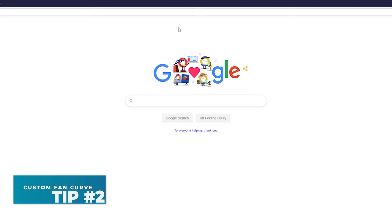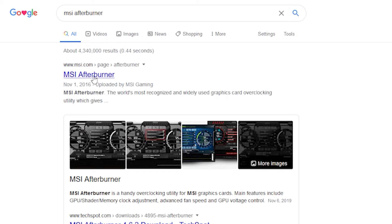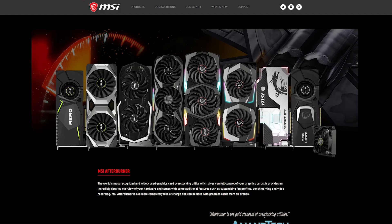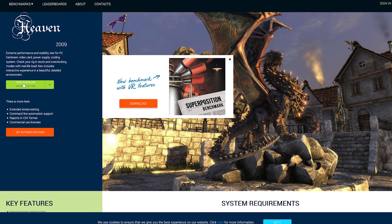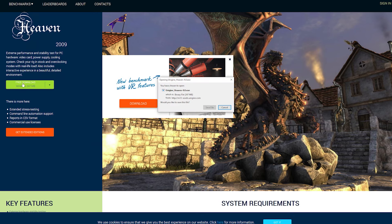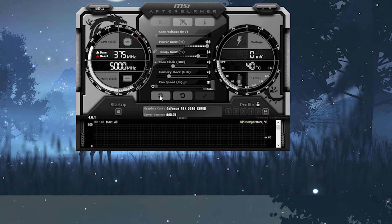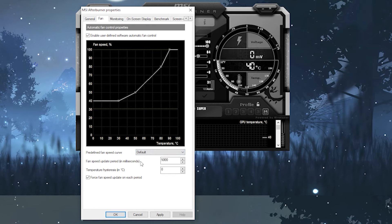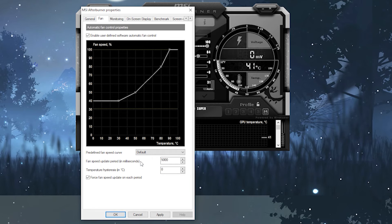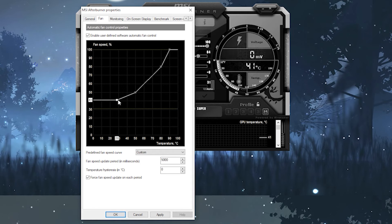Now if you have a fear of opening up your computer, taking out your GPU and disassembling it, then this next step will probably be your starting point, and that's creating a custom fan curve. You can use any software that can control your GPU, but for this I'll be using MSI Afterburner and Unigine Heaven. Head over to the Afterburner site — links below in the description — and download the install. Same thing for Unigine. Once those are downloaded and installed, open up MSI Afterburner and click on the settings button. Select the second tab labeled Fan and click to enable user-defined software automatic fan control. Using this graph, we can set up a custom fan curve that can either keep your fan noise low if you don't mind higher temps, or crank up your fan's RPMs to keep those temps cooler than a polar bear's toenails.